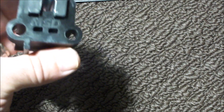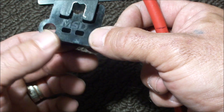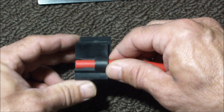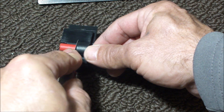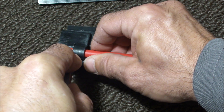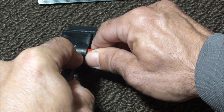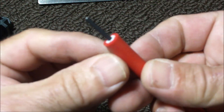This tool comes with a built-in strip guide and you'll see there are two different sizes. We'll insert the spark plug wire into the correct size guide for 8.5 millimeter wire, and using an exacto knife or razor blade, I'm going to press down and rock it back and forth while turning it. This is going to strip it down to the wire without nicking the wire itself. It pops off nice and neat — a nice clean cut end.